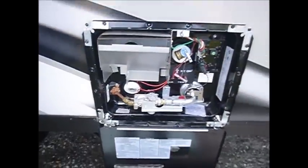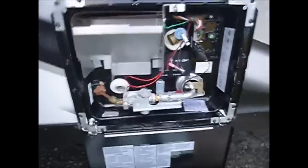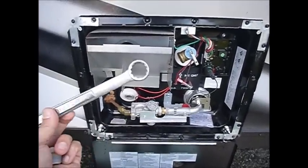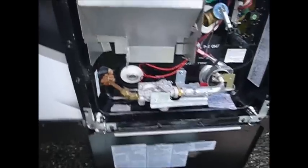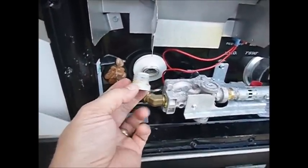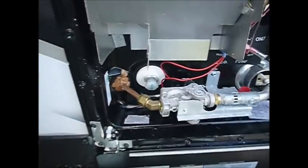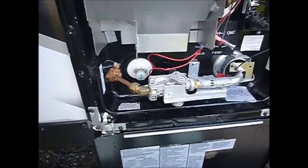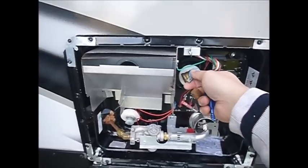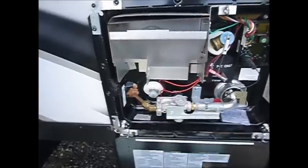After that, come up to the hot water heater on this side and use a 15/16ths wrench. It's helpful to have the closed end so you can get onto this plastic plug that threads into the drain for your tank. Pull that out slowly and it'll start to drip, then pull this up to let air into the top of the tank so the water flows out easily.